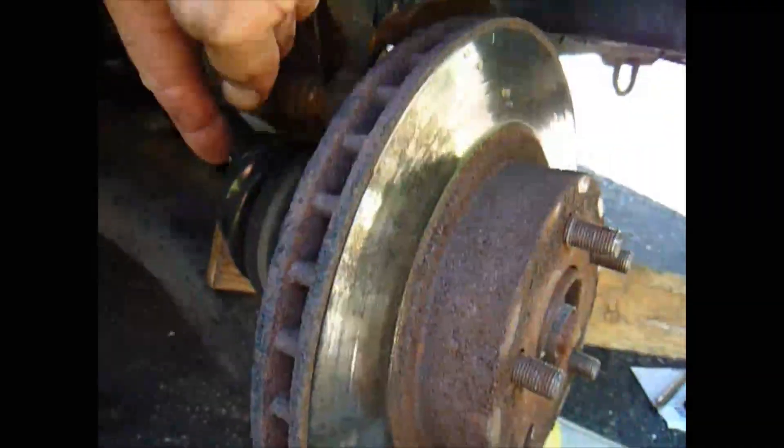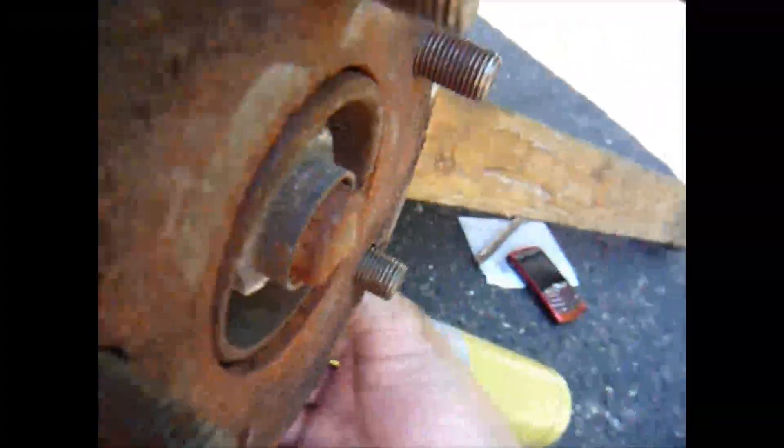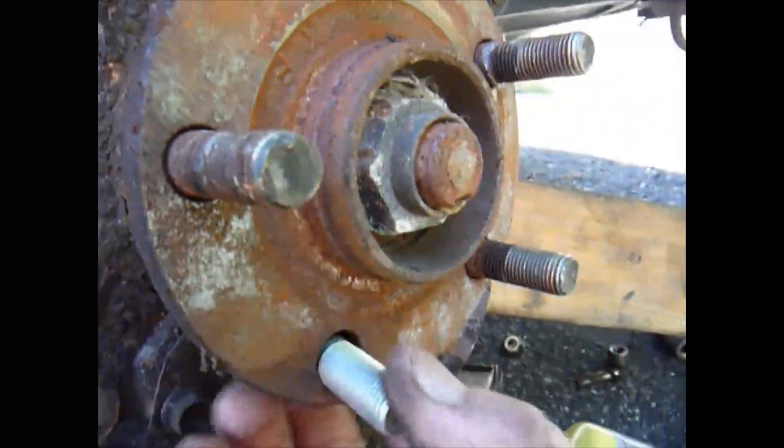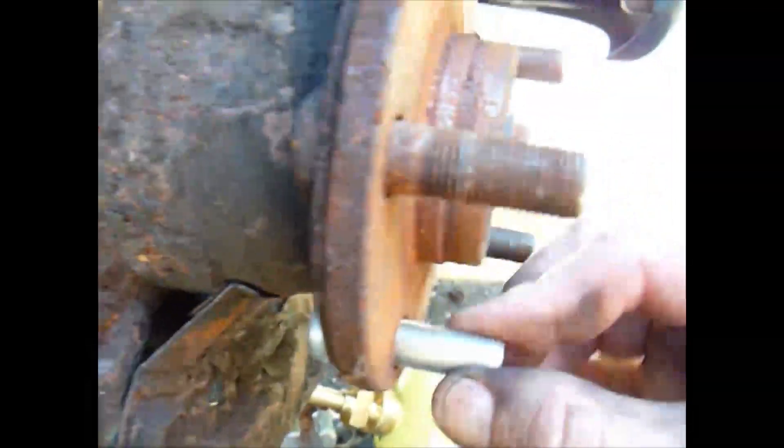With all the work I've been trying to get that loose, the rotor rust must have given. So there's what she looks like. Now I'll just slide this in there and put some grease on the spline so it'll pull in.